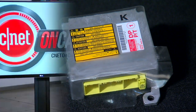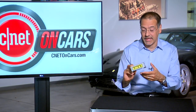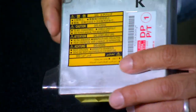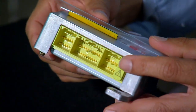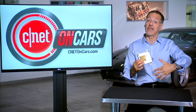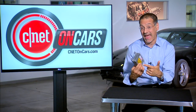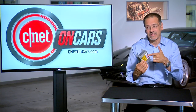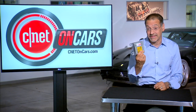Now, the first disappointment is this silver box is a black box. There really aren't any black boxes. It's kind of like in airliners. And what this really is, is the airbag controller from a 2003 Camry. You see, airbags can only work if they know what's been happening to the vehicle, so they can predict if they need to blow the bags in the next few milliseconds. This becomes a data recorder for that purpose and a data processor, hence its existence.